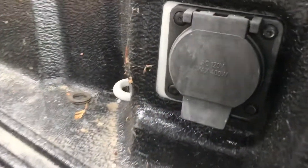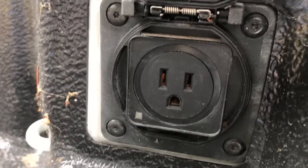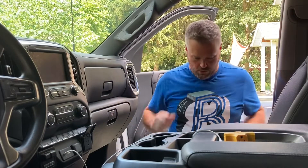This truck has some cool features — like a lot of newer pickups, it actually has power outlets in the bed. We're going to go back and test that as well. My expectation is that the output from the dash plug and the plug in the bed will be the same, because according to the owner's manual the load of this built-in inverter is shared. My guess is there's one inverter that powers two separate outlets in the truck.